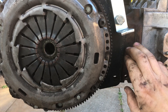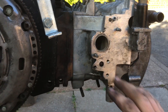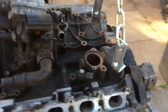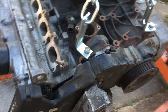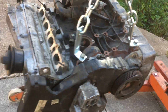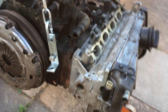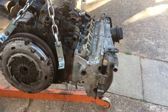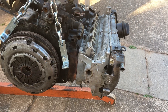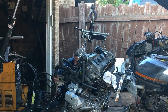At the same time, you might ask: if it's only the block that's bad, why didn't you just buy a short block? You've got a good head. Well, I could do that, and yeah it's cheaper, but then you've got to buy a head gasket kit - and they're 100 pounds on their own - and then you've got to spend on the head gasket bolts. Better to buy a whole engine, and then I can sell the good head that I've got in the garage that I don't need anymore.